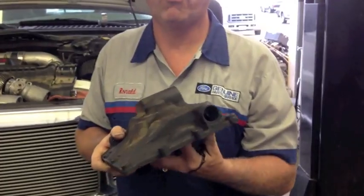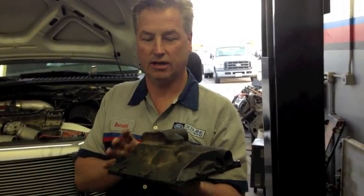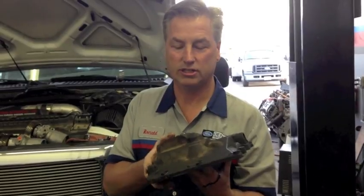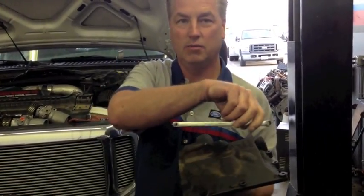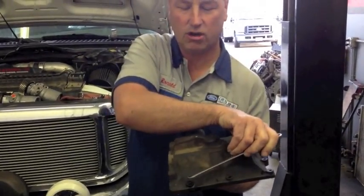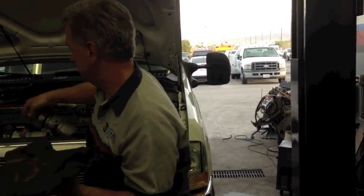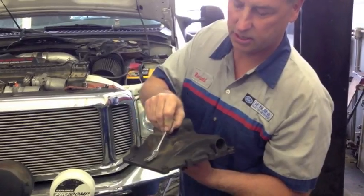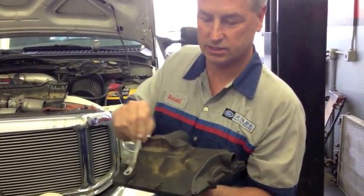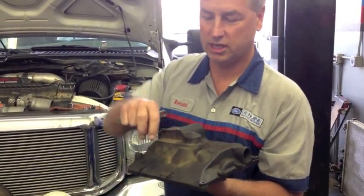If you have the 04 style or the 03 style, on the 03 you can't get it off without taking the intake off — you have to pull the complete turbo intake off. On the 04, you can pull just the turbo off and remove the cover without pulling off the intake, the EGR cooler, and all that. Two tools we use: one is a long Snap-on 8mm wrench to get underneath the EGR cooler and break the bolts loose. The other way is using a ratcheting wrench to reach underneath the EGR cooler and get them out, including the back one behind the EGR cooler.